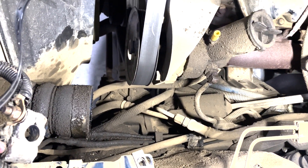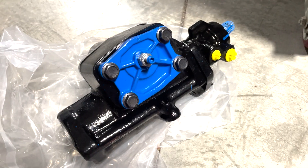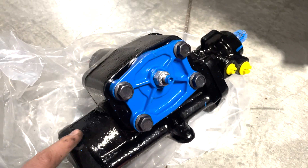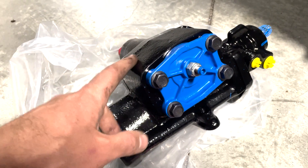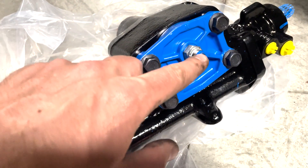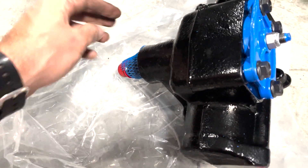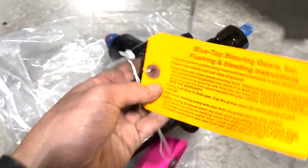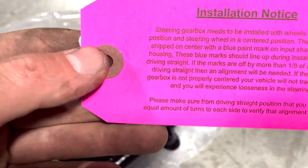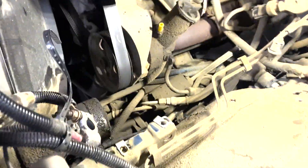Now I'm going to open up the new one so I can get a visual on what needs to be taken off, disconnect the drag link on the bottom, and then pull the pitman arm. Here's the new steering gearbox from Blue Top. I've had a Redhead installed on my truck before and was pleased with it. I heard good reviews about the Blue Top, and also that it does not void the warranty to adjust these. It comes with a flushing and bleeding installation guide, and a warning to make sure the wheels are centered up before installing it.